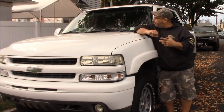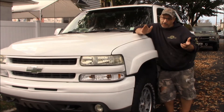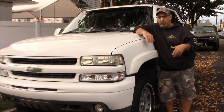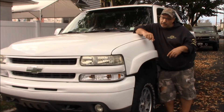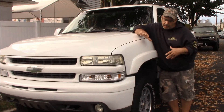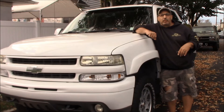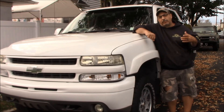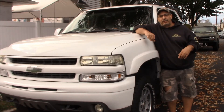Hopefully we'll be able to lower it just a little bit, make it look nice, and have a good gap between the upper control arm and the bump stop so it's not riding on that bump stop giving a harsh ride. This is Barry. Barry isn't really replacing Pearl - we don't know what we're doing with Barry yet. We're gonna do some work, make Barry look good, drive good, function good, get everything working, and then decide Barry's future. I was never a big fan of an all-white truck - the grille, fender flares, bumpers. We'll see how it turns out. Maybe we'll play around with some stuff. That's it from Axle's Garage - the addiction continues with another project vehicle, Barry White.